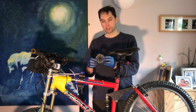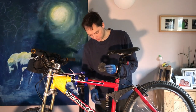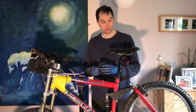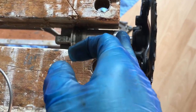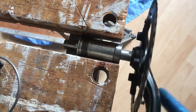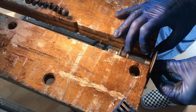It's not going to work on this bike because there's no gap, but on my son's bike there is enough gap. I thought I'd leave the Switch kit on this bike but pop the PAS disk on and try the pedal assist sensor at different angles and orientations to see if it works. There wasn't enough room on my son's bike between the bottom bracket and the crank, so I've made a little mock-up to test the different angles and see what drives the wheel.